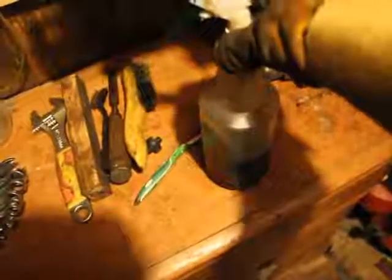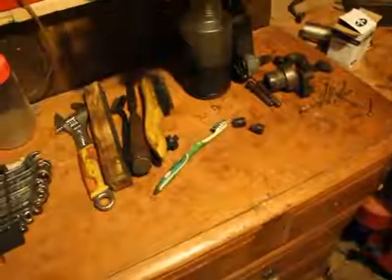If you are going to do this, one thing that's really helpful is a spray can or spray gun. I just got this from the dollar store, and you put some diesel and oil inside. I do put some oil, because if you just put diesel, or especially gasoline, it'll damage the little rubber seals and ruin the spray can. Maybe if you have a proper oil can, that won't happen, but in my case I just have this little cleaning can. It won't work anymore if you just put diesel in. But if you mix it with oil, it doesn't have to be a lot, it stops that from happening, at least for a week or two. That can didn't cost much.